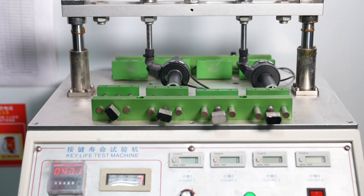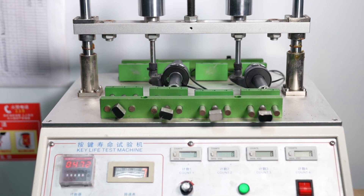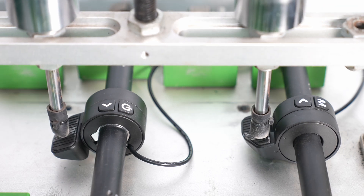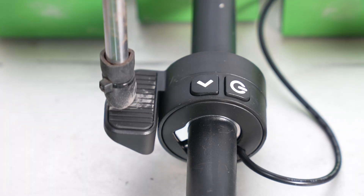Lastly, our throttle testing. This one is one that you saw at the office — we have it back in Montreal, but we also have one in China. It's a simple rig that just presses and releases the throttle for hundreds of thousands of times. From all the other throttles we tested, the maximum is 100,000 cycles — 100,000 press and release. So this throttle rig is part of our incoming QC. Every batch of throttles we receive, we're gonna put 20 to 30 pieces, depending on how big the batch is, and test them to ensure that nothing changes from one production to the other.